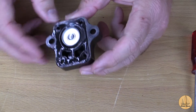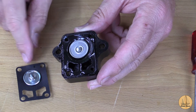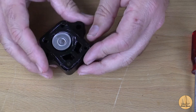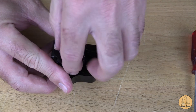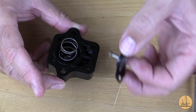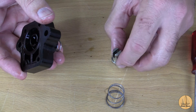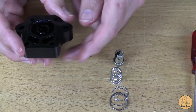The next part we're going to look at is this next section. On the backside it's got this little T shape, which tells me this lifts up and twists. I'm going to push down against the table to do this. And sure enough, it just lifts right out. You want to be very cautious - there is a spring in there. I'm going to start with taking this big outer spring off, turn it over, pull this one out, and leave them all sitting in the way they came out so I know exactly what order to put them back in and which side is upright.